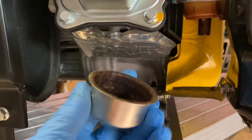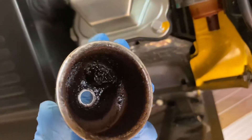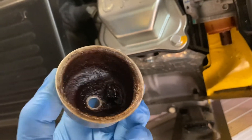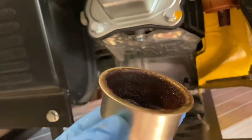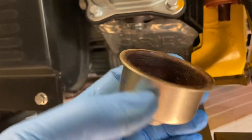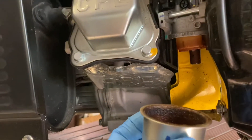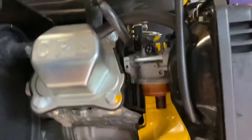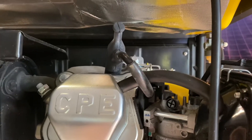So I came home today, shut off the valve to the fuel, and took off the carburetor bowl. Look at that grime inside the carburetor bowl. Also notable: when I took off the bowl it was empty. Ding ding ding — bingo. We are not getting fuel. We have air, we have spark, we do not have fuel.